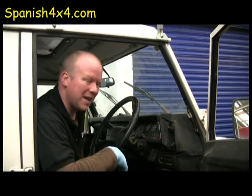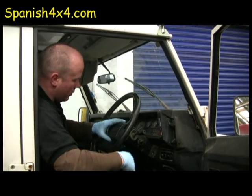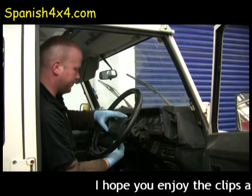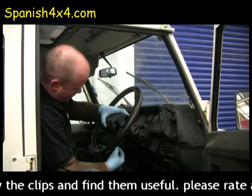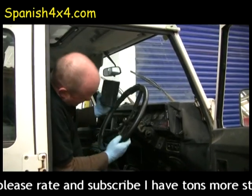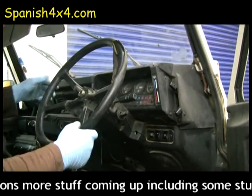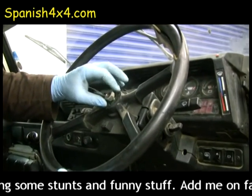We're back on the ramp, and I thought I'd start with the inside and basic stuff. Steering wheel. Whatever model you've got, there are various different steering wheels of course, but all I can show you is what I've got. Defender, one screw through the bottom into that hole holds the cover on. So I take that off, and then I've already done some prep work. You've got a big 22mm nut there.